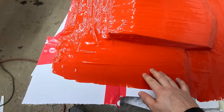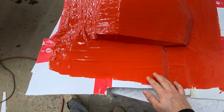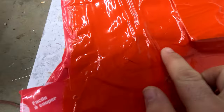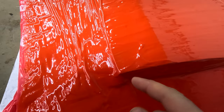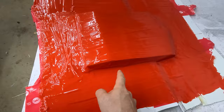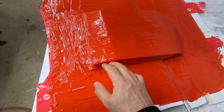It's been a quick 12 hours. Things are kind of tacky — I'm not overly concerned. This all looks really good. I know you guys are probably like 'oh my god, it's streaky,' but underneath it won't be streaky. My concern, however, is my mold where the tape was adjusted — we kind of have this underlying cut here. I'm hoping that once we put the fiberglass on and pull it apart we can repair that. Unfortunately we won't know until the entire mold is done. We're only halfway through — we have the entire other side to do yet, probably another four to five hours of work. This might all be scrapped, so we're going to keep cruising along.